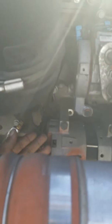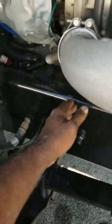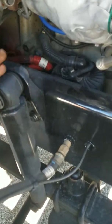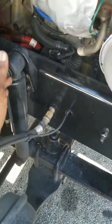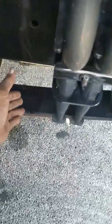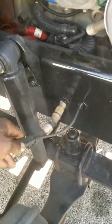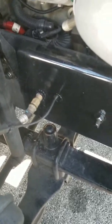Work your way out on your chassis — put your hand on your chassis, not cracked, not broken. Put your hand on the shock, not cracked, not broken. Bottom — not cracked, not broken. Leaf springs — not cracked, not broken, not missing. Then you go to your brake lines: not cracked, not broken, not leaking.